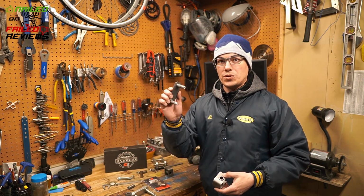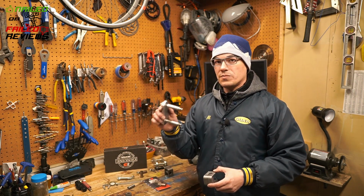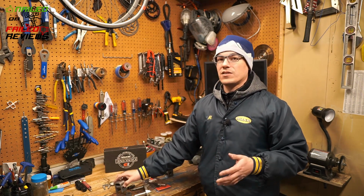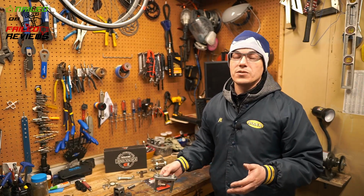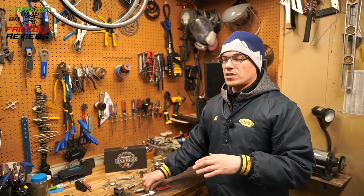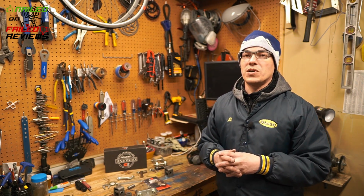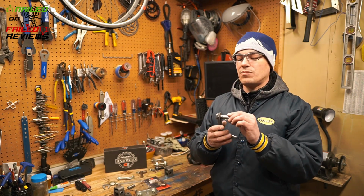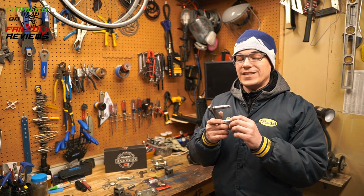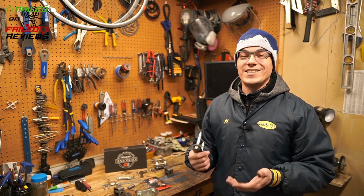They'll either use your old shackle kit, which goes in there just fine, it fits, or if you want to pay for it, you can upgrade to the Dexter axle kits. And usually the good trailer shops around you are going to be selling all these bolts and shackles individually because of the different sizes that are out there. That is the big thing that you need to figure out: whether or not that top bolt is worn out on your upper shackle. And if it is, I really would suggest you continue watching the video to see my DIY fix.